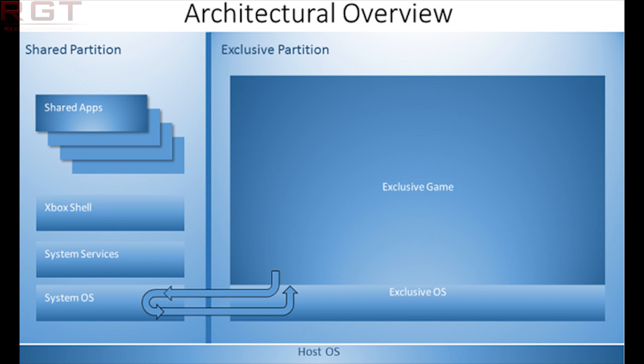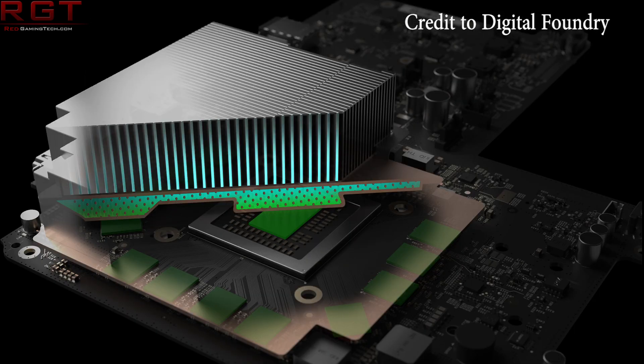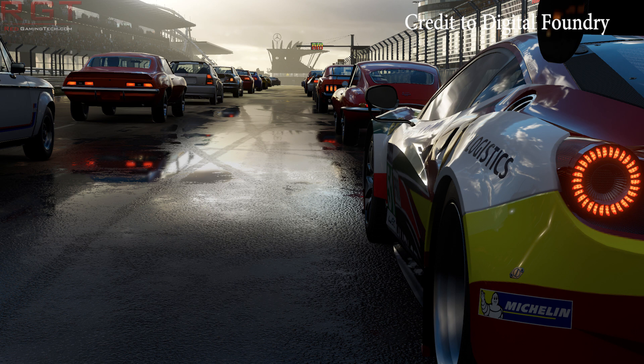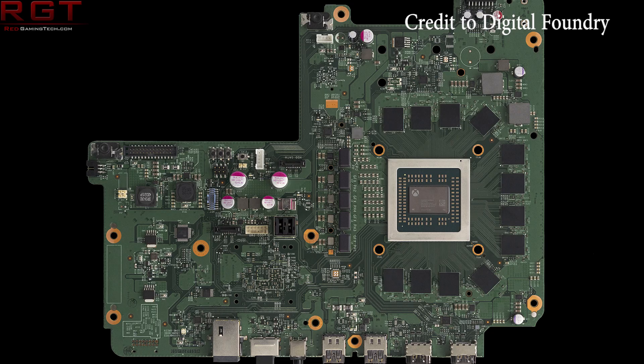Now, one of the more infamous technologies inside the PlayStation 4 Pro was double-rate FP16 processing, but according to Andrew Goosen from Microsoft, they have not added that into the Scorpio. But they did put a number of other extensions and customizations into the GPU. Despite that, they're actually faster on the GPU. You might think sending more commands to the GPU slows it down, but as Goosen says, very rarely do they draw-bound on the command processor. Even if they were to draw-bound on Direct3D 12, they have a more efficient interface because it's built in — they don't have a very big, noisy, abstract interface to deal with. They've built the logic right into the command processor, and the command processor can do more optimizations than can be done in the driver.